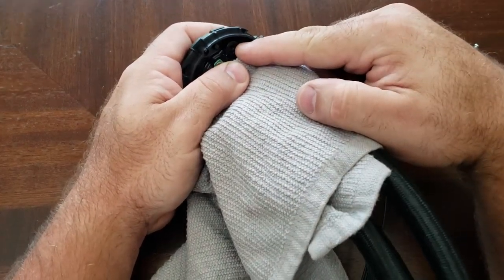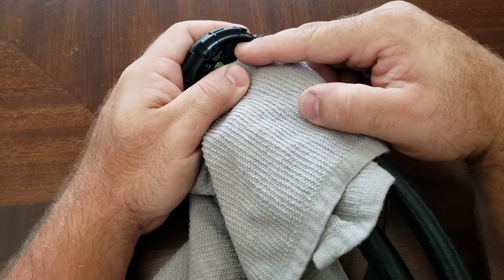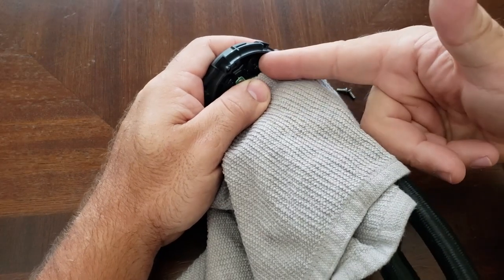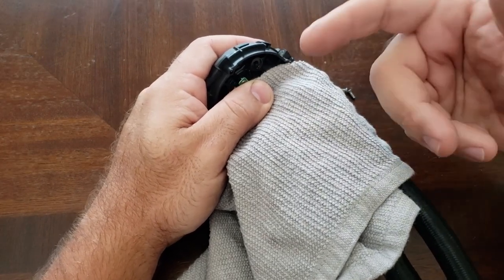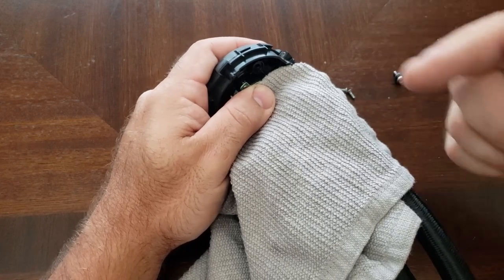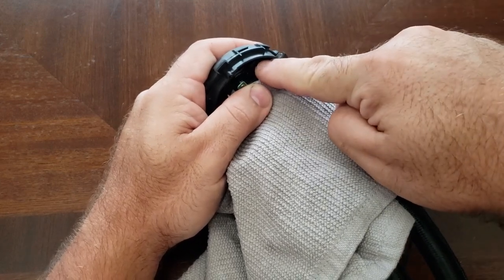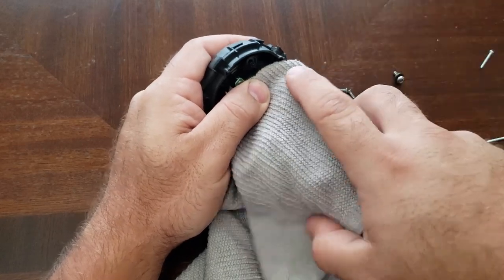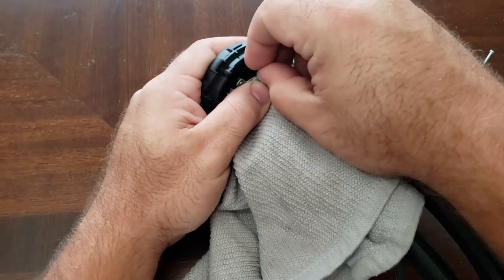You'll need a small fill bottle — you can get those easily from EK or Amazon — and you can just spray liquid right in there. Prime that spray bottle so liquid goes all the way to the tip before inserting it, because if you don't, you'll just be injecting air directly into the cooler.